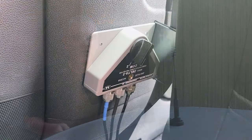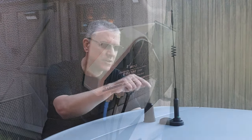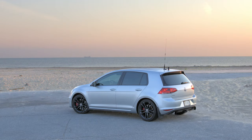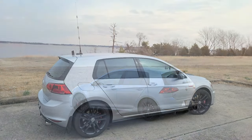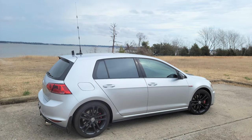For my choice of antenna, I have a wide variety. I usually prefer to have one of my wideband antennas mounted now that I have a GMRS radio and a switch to connect it to this antenna port. Today I have a Diamond NR73B NMO mounted. Sometimes I mount a smaller Tram 1181 — a quarter-wave antenna — or maybe a Comet CA2X4SR NMO. All of these antennas cover two meters, fire and rescue, 70 centimeters, the weather band, and the GMRS band, so they're very wide-banded. It all depends on what I want or expect on the road.